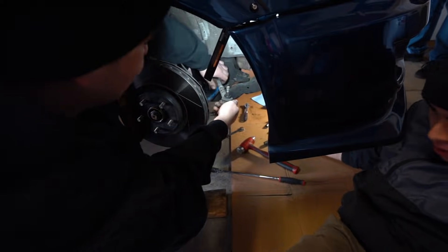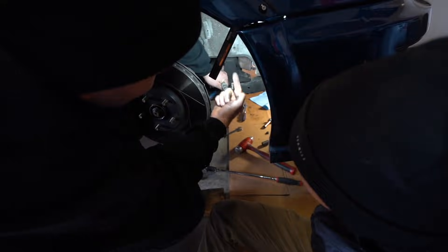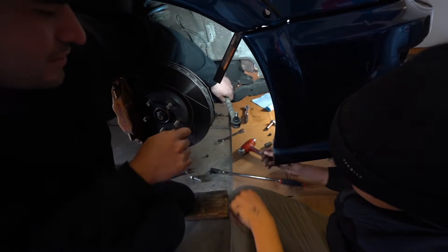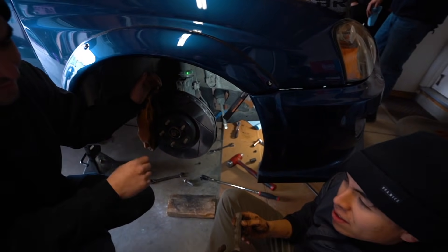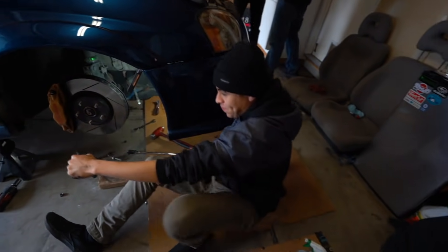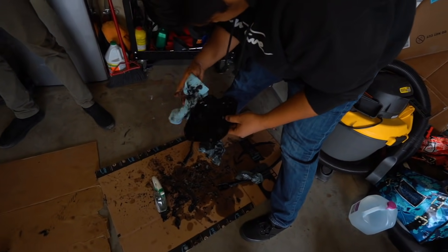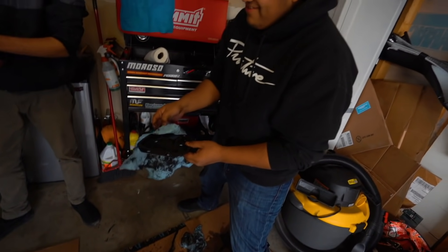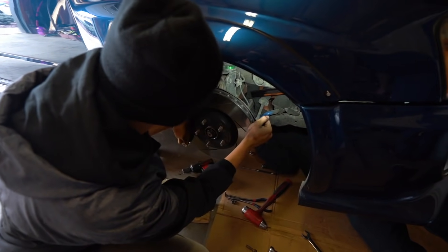So you know how far — it's going to point up. You're going to turn it, loosen it, and that's one turn. Every time it points up, count it as one turn. So we're going to mark them down — 16 turns on one side, 17 on the other, and 18. We'll record these so we can get the tie rods back to the same position on the new rack.